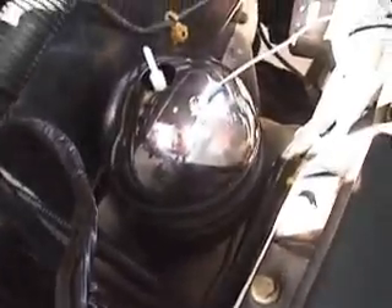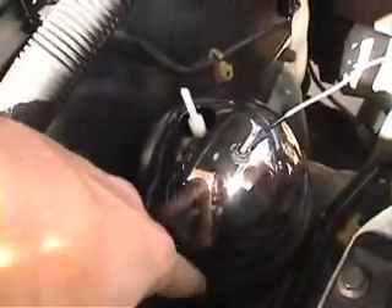We have a nice space in here — this is a 2001 Land Rover Discovery V8. We've got a nice space for the Mojo, at a perfect angle to bring the tube up. The Mojo car kit is hooked up in its space, sitting on a rubber gasket. We have our positive coming through, wired to a switch, and we'll apply it to the positive on the battery. The negative comes from underneath the cell and hooks up to the negative connection.